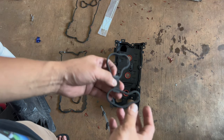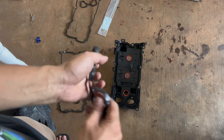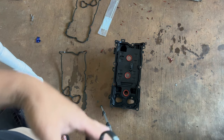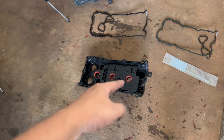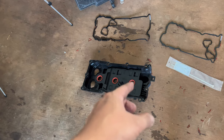We put the last ones — eleven and twelve — as well as the cam position sensors back. Now I'm going to get the torque wrench and tighten it down. What I found online is it's going to be 5 through 6 foot pounds. I'm on 6 foot pounds. I'm going to tighten it down in the same order I showed you: one through ten. So the tightening sequence for this is one, two, three, four, five, six, seven, eight, nine, ten — that's how you tighten it in that order. Now that we tightened it to spec at 6 foot pounds on each bolt, next up we're going to put the spark plug coils back. Lucky we labeled them by number. It's one, two, three, four, five, six.